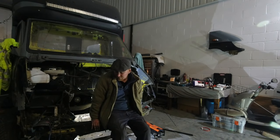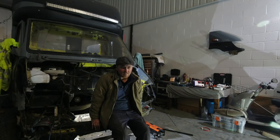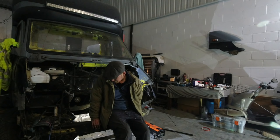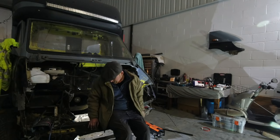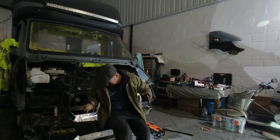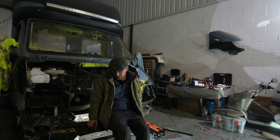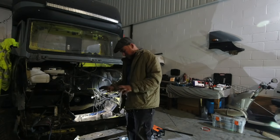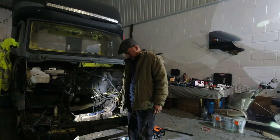So the steering racks are different. There's two different steering racks for the 15-inch wheeled Sprinter and the 16-inch wheeled Sprinter. They look identical until you get them next to each other, and then you just see very subtle differences. The donor truck's one is a little bit thicker. It looks the same in sort of length, but then the suspension arm is probably an inch longer. Worst of all, the whole front subframe, the mounts that hold the bracket on, are different by 5 mil. Unbelievable.